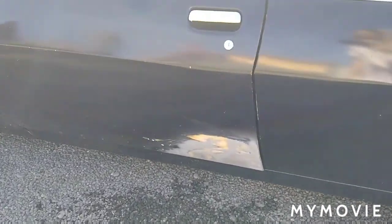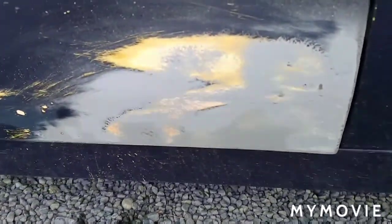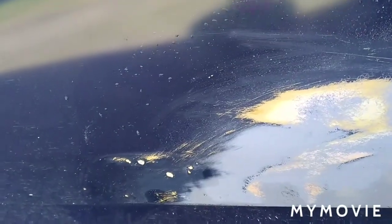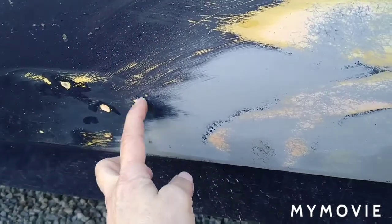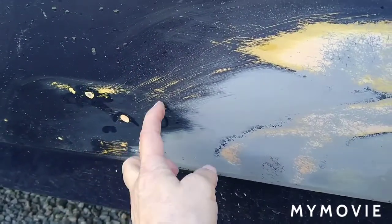I've started on this HQ and I'll show you what I'm faced with. I'm just looking at painting this panel down here that has already had a repair. I used a block with a bit of sandpaper on it, so it's flat. And you can see over here where those round bits are - that's high spots. They're probably bits of rust that are starting out under there.